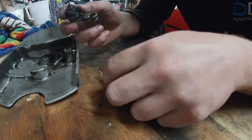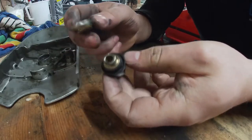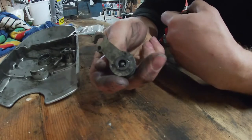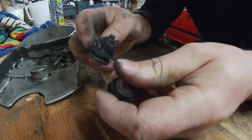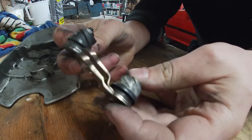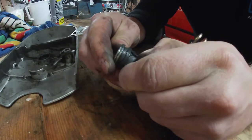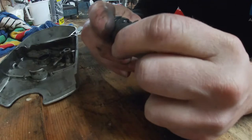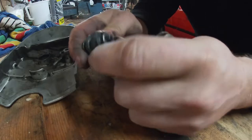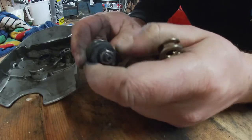As I was inspecting the old with the new part, you still actually have to mount these together. I think you have to crush this tube so it looks like this. But what I just realized is that this worm gear is cracked. This is one piece, this is cracked. And actually, I think I can move it slightly. Yeah, I think I just moved it. Oh yeah, here we go. So I think this is my problem. Look.